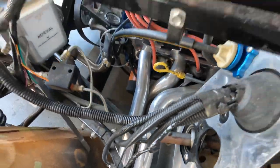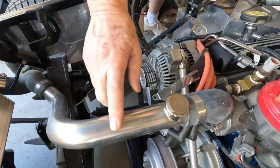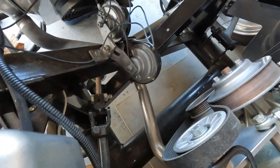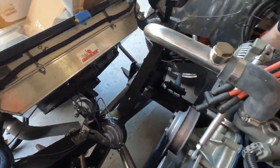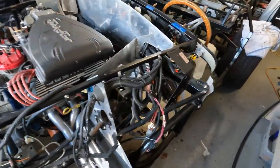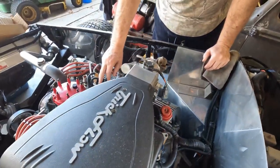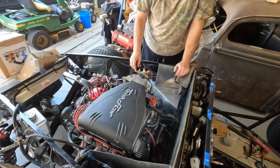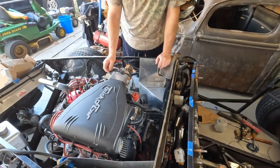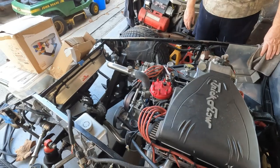It has a 130 amp alternator, stainless steel piping, and the high end aluminum radiator. Cool. Okay. So we're not far from starting. Yeah. It's 30-pound injectors to go with the cam, and it has a 70-millimeter intake. So we should be getting pretty close to the 350 mark.